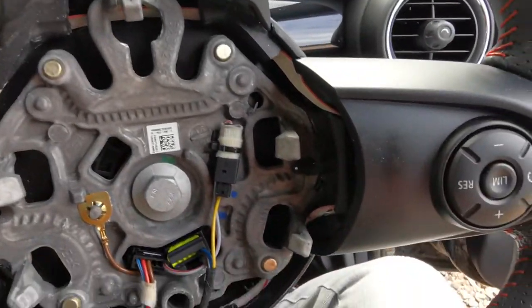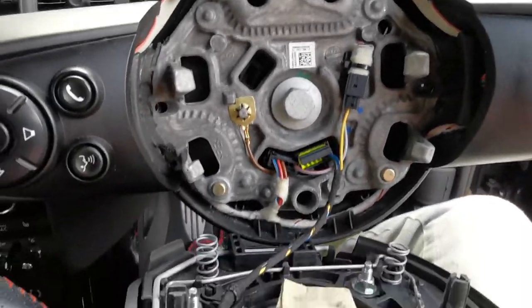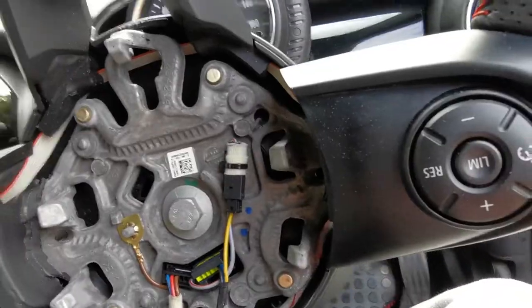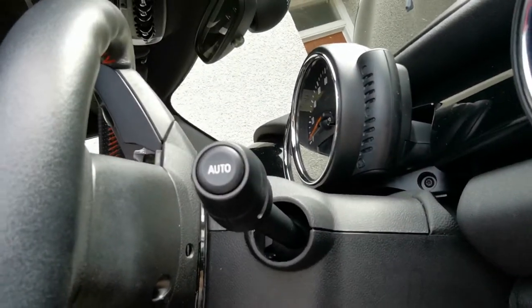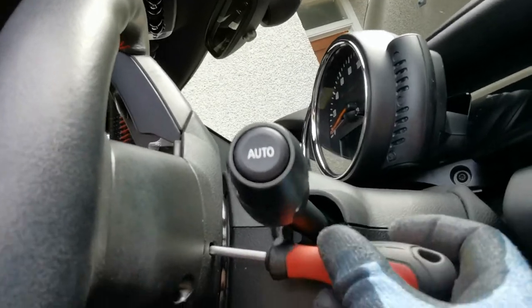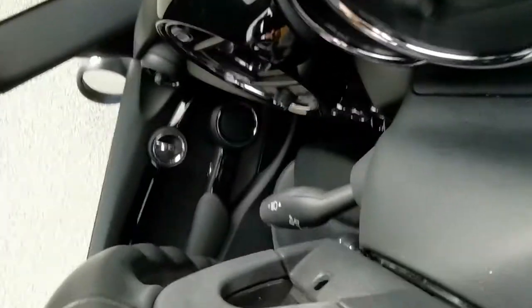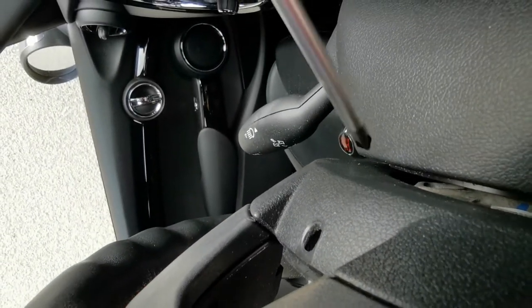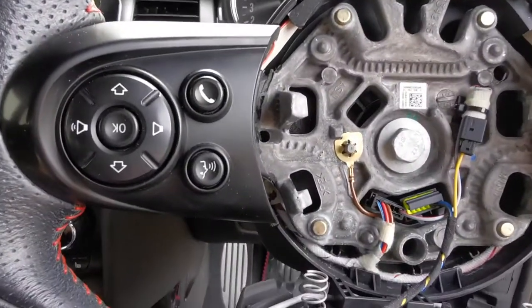You can see there are one, two, three, four, five of them. To get them off, take a screwdriver and look around the back of the steering wheel — you'll see there are a couple of holes. There's an identical one on the other side, and on the back of the steering wheel you're looking for this one in here as well.